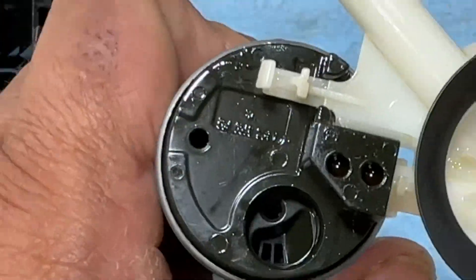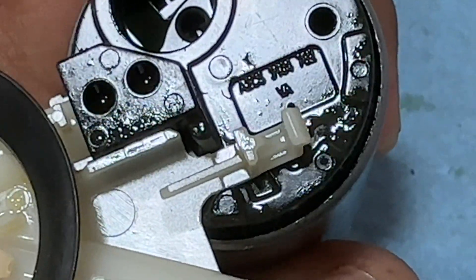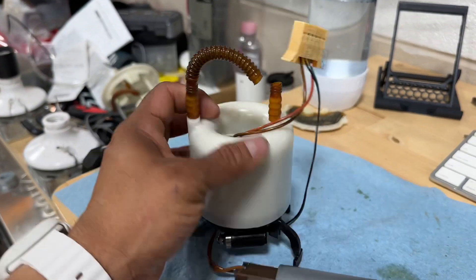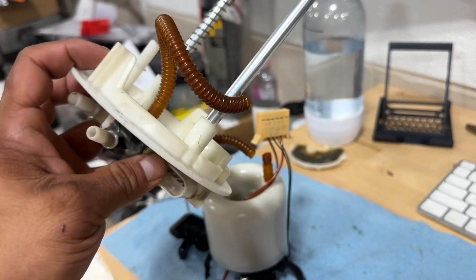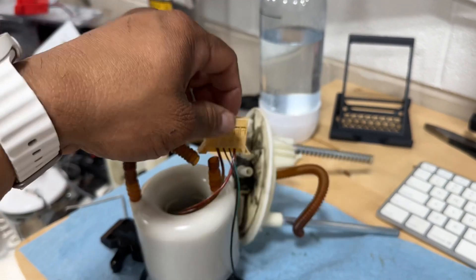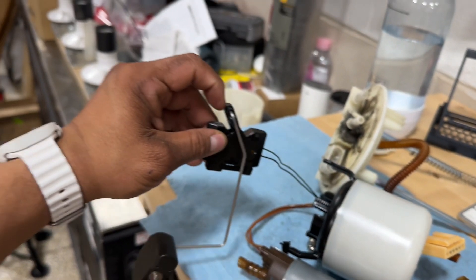Let's see if there are any more part numbers here - I'm having trouble reading them, but there's a 303-something. I'll try to get the magnifying glass and put it in the description. This is the fuel pump, and you can get replacement hoses. This is the connector that plugs in at the bottom and 90-degrees out at the top, on the outside of your tank. The harness plugs in there: two wires feed your motor and two wires feed your fuel level potentiometer - your fuel sending unit.